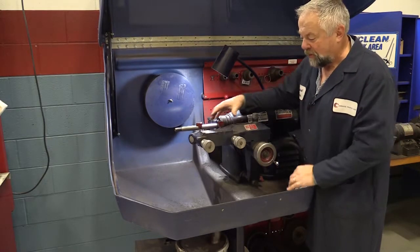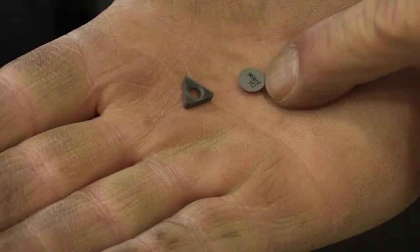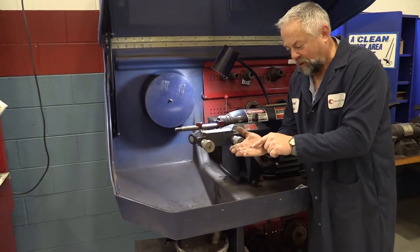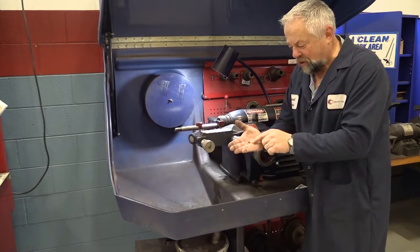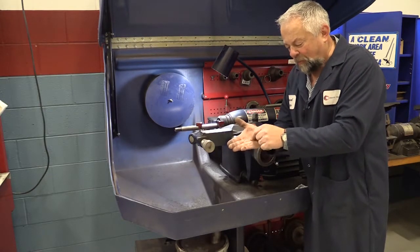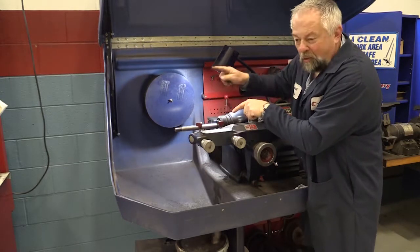Let's talk about one more thing — the actual cutting bits themselves. I've got a couple of different bits here that we use in this machine. One is the old triangle that came with it; some people like the round bits. This one is set up right now for the triangle bit. This particular brake lathe is what they call a negative rake. You can actually take this little triangle, use all three points, then flip it upside down and use the three points again. On a negative rake, the bits are pointed downwards. On brake lathes designed with a positive rake where the bits are pointed up, you only get three chances — you cannot flip it upside down.